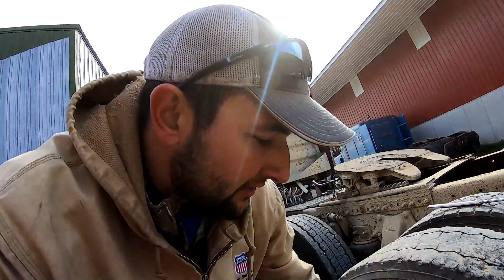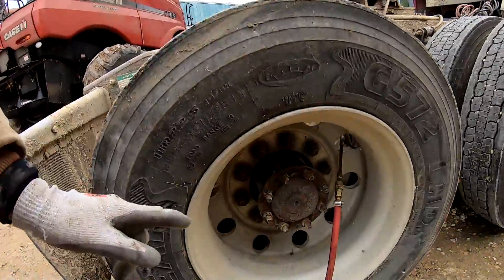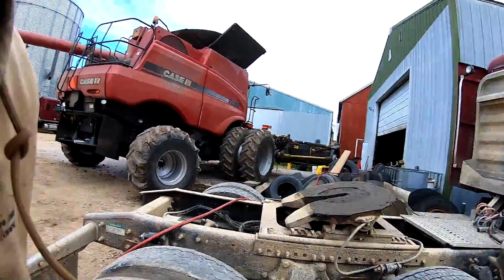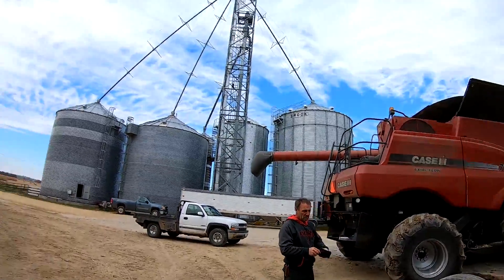Put air in the tires, give it a once over, add some oil, add some coolant — all good. Checking tires on a semi is not fun. There are 18 tires to check and half the beads are way in there. I got to check all the tires, add some engine oil, add some coolant, grease the fifth wheel, put a tube of grease on there, go hook onto the trailer, make sure all the lights are working, check the trailer tires, and then should be good to go. Maybe oil up the traps too.